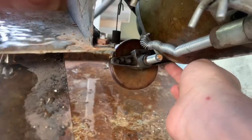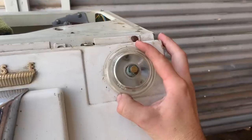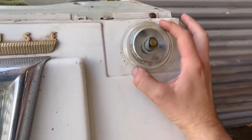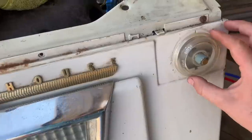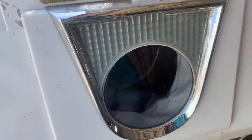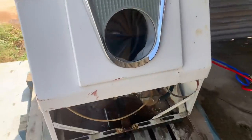What you're seeing here is the pump spring broke. This solenoid will engage and pulls this wheel up and turns it, which turns the front pump and gets the water out of the machine — and that spring is broken. That noise was the solenoid kicking in and it's turning but nothing is happening. I got to replace that spring. We're going to cheat a little bit and make it go through its cycle faster, because I want to get to the spin cycle to make sure that's working. You can see the back wheel is turning a lot faster now — so the spin cycle is definitely working. Make sure you like this if you got value out of it, and subscribe and follow my TikTok for more content like this.